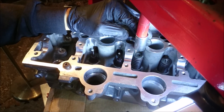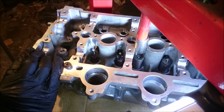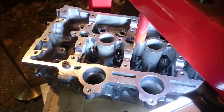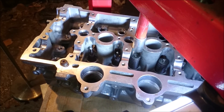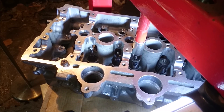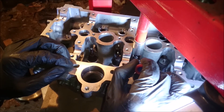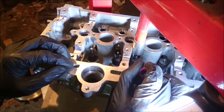I have seen other chaps use a pillar drill for this, which again, not a bad call. That's not quite squared up right — and that caught the edge of the valve seat there. Still not happy with that. You want to make sure you're happy and square, otherwise the collets won't go — ah, there we go. Can you see the difference? Hopefully you saw that — where the valve stem itself is in there. I wouldn't recommend, at all, getting your fingers in there, so the screwdriver with just a little bit of grease is holding the collet on the end, because the magnetic side of this has gone a long time ago.